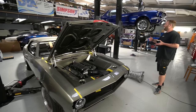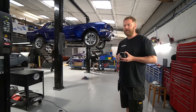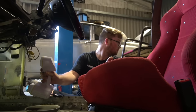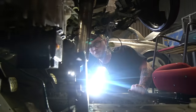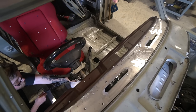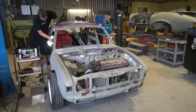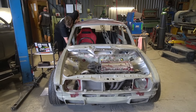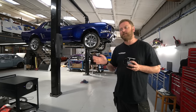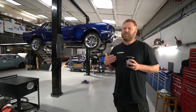On to the Allegro: Luke is on with quite a lot of interior design work, which has been on the cards for a while. Just before I went away they did a 3D scan of the inside with the dash in place. We've used the original dash but modified — extended at the front to bring it further into the car. The structure of the original dash piece is going to be retained with some modifications. All of the lower sections below that upper raised section — where the glove boxes would normally be, where the steering column goes — will be one-off. The whole central section, which is normally a flimsy plastic piece in the Allegro, will also be bespoke. We're now roughing out the ideas in CAD, knowing more about what components are going into that interior.